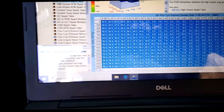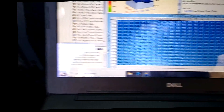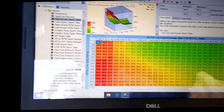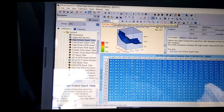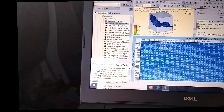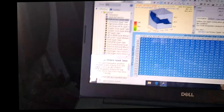I did a video about a year ago explaining that, and several guys called me after saying they set their Aeroforce gauge to show closed loop vs open loop. They drove to stay in closed loop, and it wasn't even a lot of difference in pedal position or miles per hour - just a few miles per hour, a few percent of throttle - and they increased their mileage dramatically. When you start bringing those performance enrichment parameters down, you're running the risk of running in performance enrichment longer, even during highway cruise, getting worse economy.